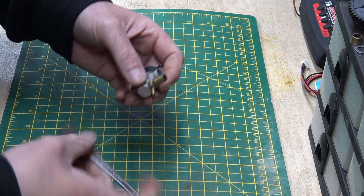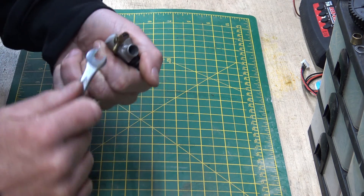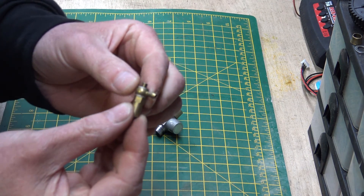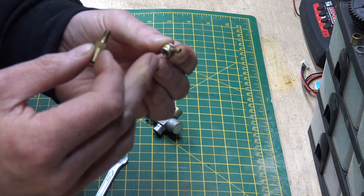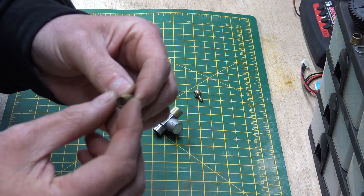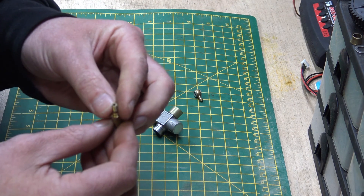I'll show you all the little things. You need a little spanner, and you can take off this high-speed needle - it just unscrews like that, and that's where it goes in there. What you end up with is this, so you can then take that off. You've got two little washers at the top and the bottom, so be careful with those. And this is your needle.